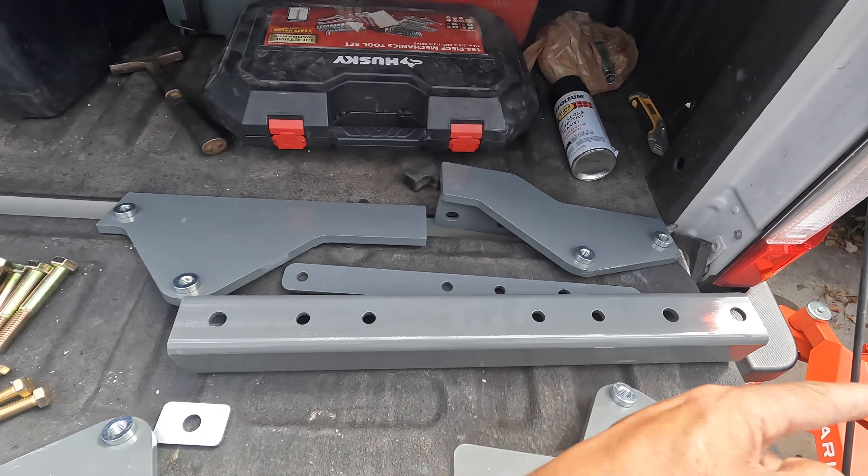I raised up my airbags in my truck to give me a little extra working room — see those little airbags right there. Man, it makes this thing fricking high. Here's another look at my little setup. I measured back because the instructions said 45 and a half plus the thickness of your liner, so I went 45 and five-eighths from the back to the center. Then from wheel well to wheel well, I actually used two tape measures and did them in opposite directions — it comes up 25 and three-sixteenths. I just wanted to double-check before I made my cut.